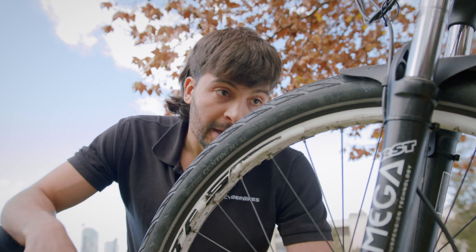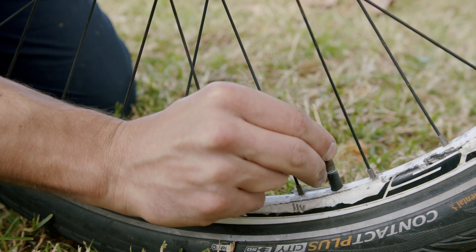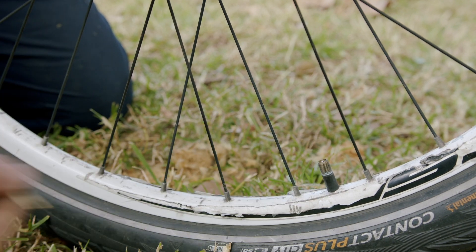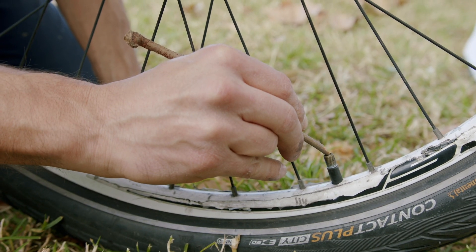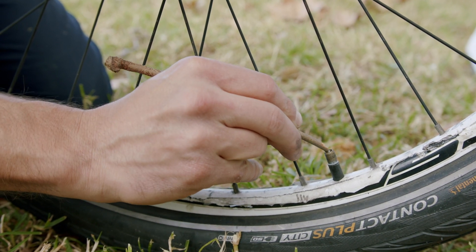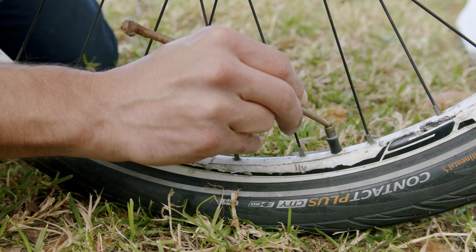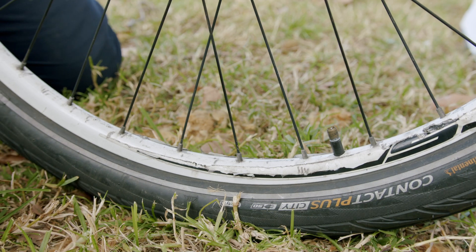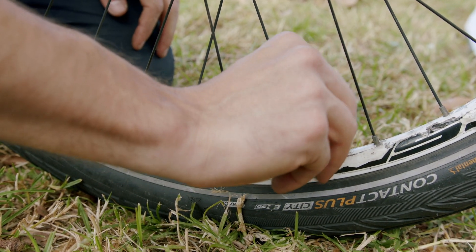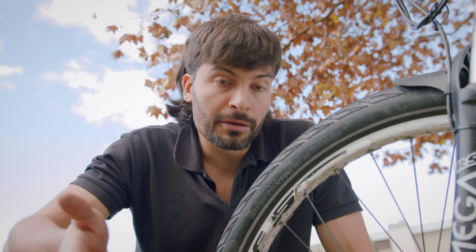What I suggest you do is deflate the tire a little bit to increase the footprint of the tire and increase contact with the soil. This is a good tip in case you choose a slick tire and you find yourself in an adverse condition.